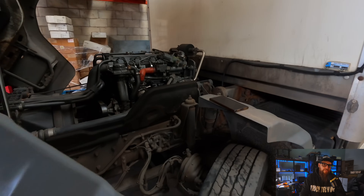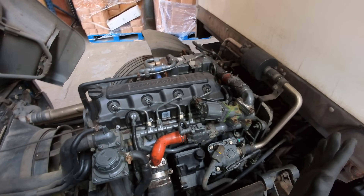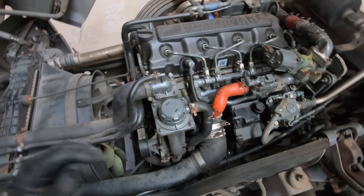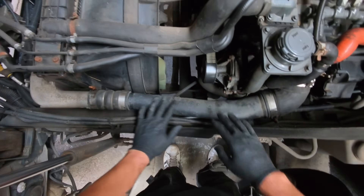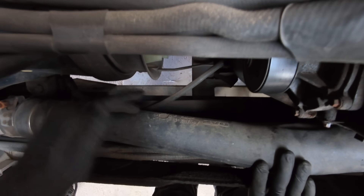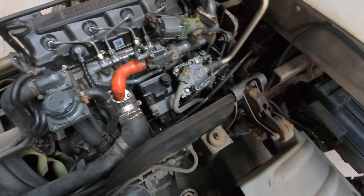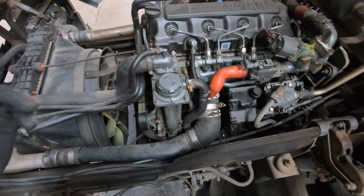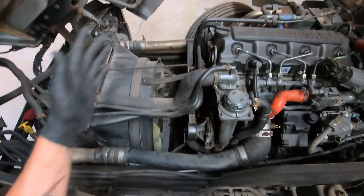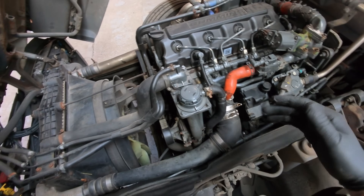Remember this LF from the last video? I had gaskets to clean the EGR system out today but I'm still not convinced. Before stripping all the engine down, I'm just going to check over the boost circuits. These pipes are notorious - absolutely notorious - for splitting, usually cracking with a big hole. I'll drop the intake off, start the truck up, blank off the end of the pipe, and we'll see if the circuit is holding pressure.